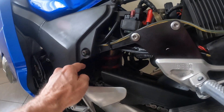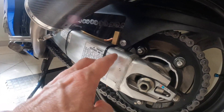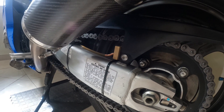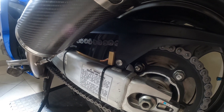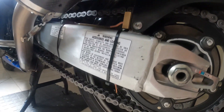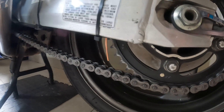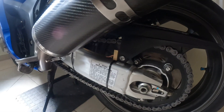There's a clear line that goes to the front of the bike, then down the swing arm, to the very back end near the sprocket area — and this is where the magic happens. Inside that little square housing there is an inertia piston that moves up and down, opens ports, and regulates the flow down the back of the swing arm onto a capillary tube which lubricates the inside of the chain.